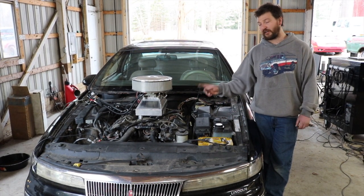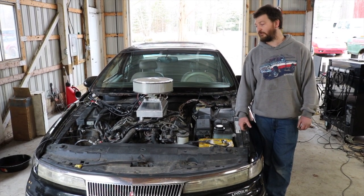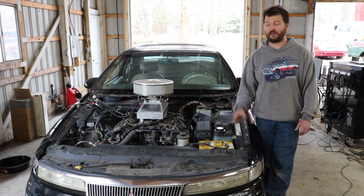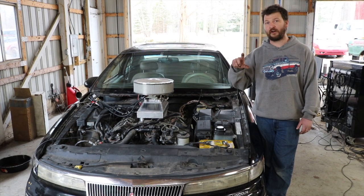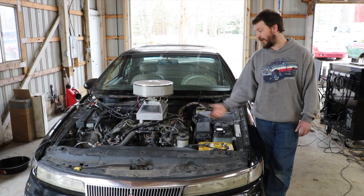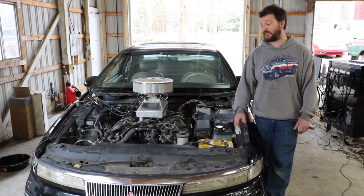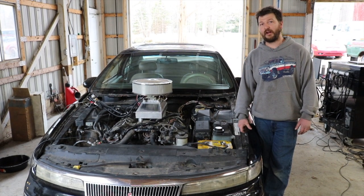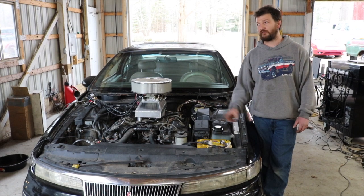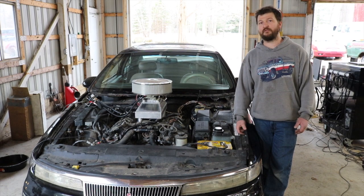Ultimately, this drivetrain is not going to go in the Camaro. The intake plenum is too big and the runner length is too short. The plenum size was based on getting 5.5 inches of plenum depth underneath the carburetor, and the intake runner length was determined by the amount of metal I had on the shelf divided by 16. So this wasn't ideal — it was just a proof of concept to see if the factory ECU would actually be able to control spark reliably and the trans would shift using the throttle position sensor from Innovate Motorsports. It doesn't matter — we aren't using it.